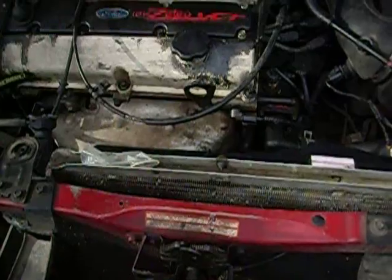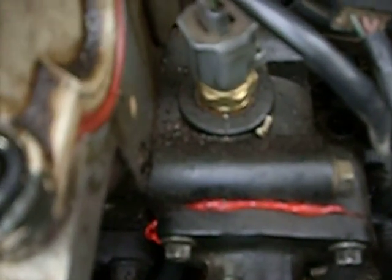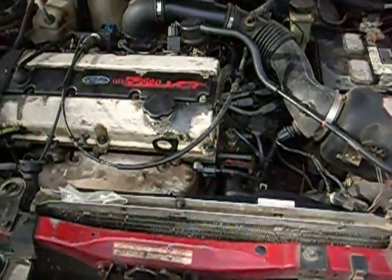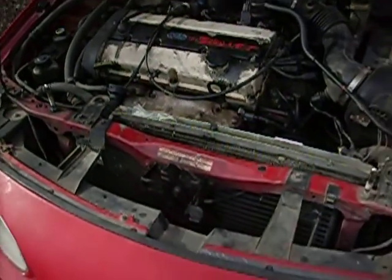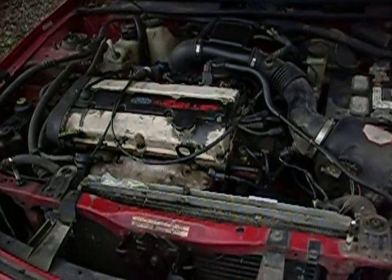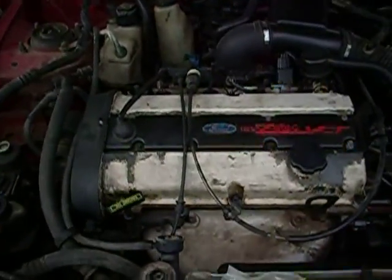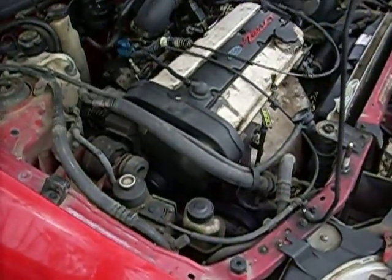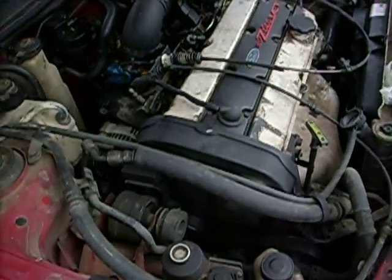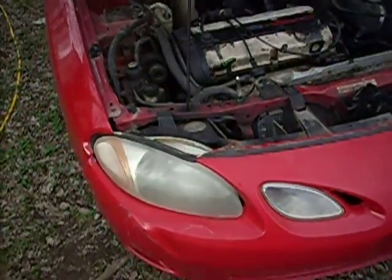So that's where we're at. The temperature gauge still doesn't work, despite the fact that the sensor looks brand new and the thermostat housing looks like it's been removed. In all likelihood, with my current employment situation — on suspension from my recent job and may not be working after tomorrow — the likelihood of me paying the $168 for the head gasket set, plus coming up with the necessary timing alignment tools for the dual cams and the retaining pin for the crankshaft to put this car on the road, is probably not going to happen. So in all likelihood, this car is officially up for sale.